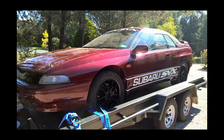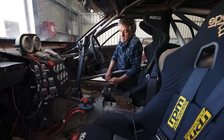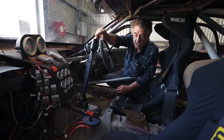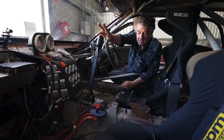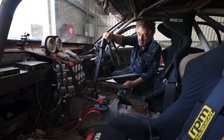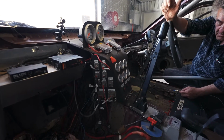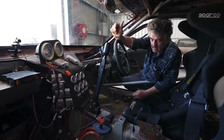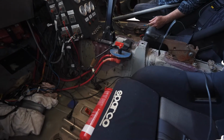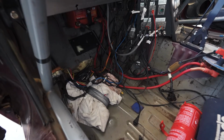It's got bigger cams and develops over 300 wheel horsepower. So what we have in here is, instead of the normal 6-speed, it's been replaced by a PPG 6-speed sequential gearbox, which makes it a lot better. It has Kaaz diffs front and back, which helps with the wheels putting the power down coming out of the corner. We monitor oil pressure in and out of the oil cooler, oil temperatures, radiator temperatures, right and left bank and the heads, and the radiator return temperature, so we know what's going on.